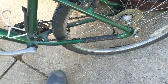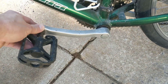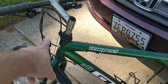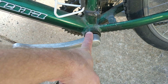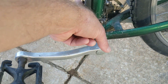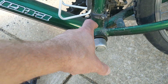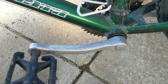You're going to want to check that your pedals are tightened properly. To do that, simply grab the pedal and wiggle it back and forth — you shouldn't feel any looseness. If you do, this adjustment can get a little tricky, but it works the same as it does for your forks. This is fun because you may have heard righty-tighty, lefty-loosey — but on a bicycle, on the left side without the chain, it's actually reverse threaded. That means it's righty-loosey, lefty-tighty. You'll need to spin that locking ring to the left and then lock it in place.